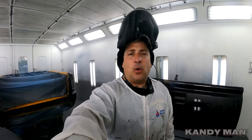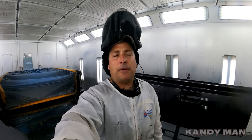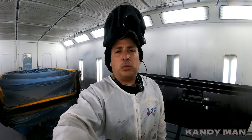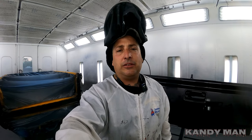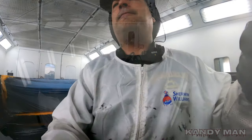And when I'm using higher solids clears, I definitely turn the air pressure up more to push that clear out. But with these thinner clears, when you turn that pressure up, all you're doing is wasting it in the air, and you're not putting any on the panel because it's breaking it up so fine and the clear is so thin, you're losing a lot of it. So let's put another coat on and see what this looks like at 18 PSI with the C2 cap, guys.